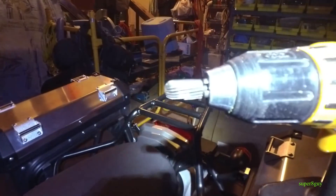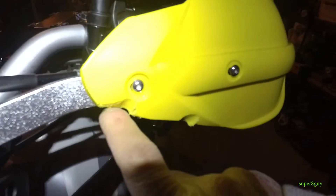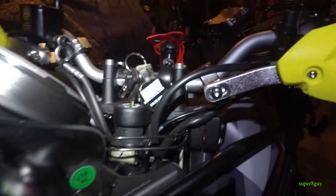Using this drill with this burr, I was able to modify and cut back the plastic in places to allow increased movement of the handlebars. You can see here is where I cut it back and also where the windscreen impacts the hand guard. I did the same thing on the other side, although in a slightly different area.